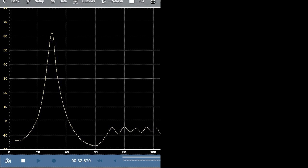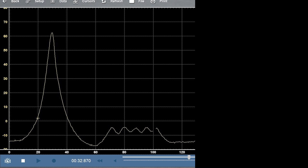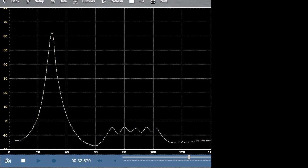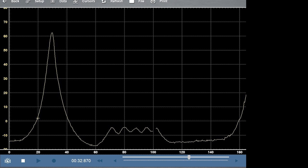We can actually measure back pressure in this area, and we also know when the exhaust valve opened. Now we're moving towards TDC of the exhaust stroke. Just before we get there, the intake valve opens — it's a period we call overlap, where both the intake and exhaust valve are open at the same time. Because of this, we can't get a real distinction of when the intake valve actually opened, but we do know when the exhaust valve closes. And that can also help us get an indication of whether the intake valve timing is correct.